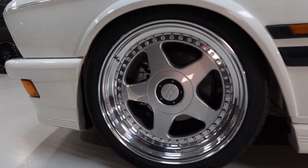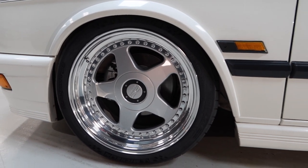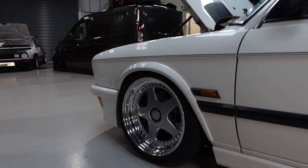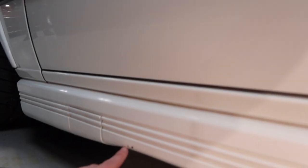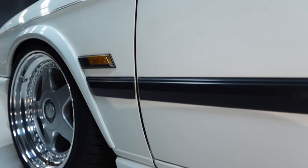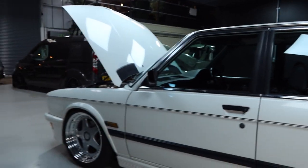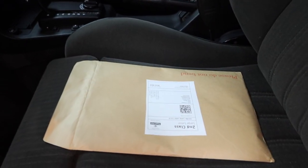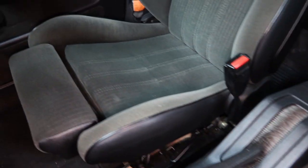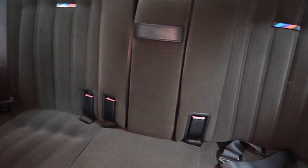We will get these wheels off now - I'm going to take the front wheels off and fit those five mil spacers so we can take it out on the road without the rubbing and scraping. We have settled down the shocks a little bit - we've been driving it as much as possible and they've settled in quite well now. We've got some touch-up on order to sort out bits like this - we're going to touch those in, flat and polish those, hopefully lose those. They're down nice and low so any sort of damage like that we can get away with doing it that way. It saves repainting parts of the vehicle and keeps it more original. The interior is in lovely order actually.